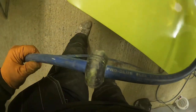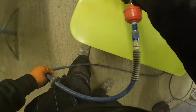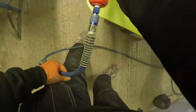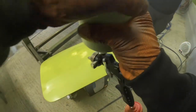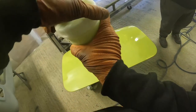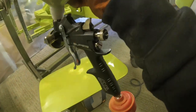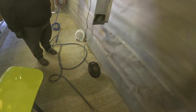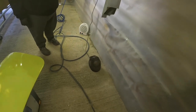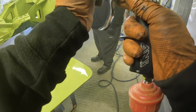And I don't know if it was just a little piece of blue roll or something that got in there from when we were wiping it out after degreasing the gun and giving it its initial clean out of the box to get all the assembly oils and things off it. But there was just something not right, and that's why I was even checking the cup, making sure it wasn't restricted or something in there, making sure that the top hole, because if they block up, they can restrict the paint flow. So I was just testing it on the plastic on the wall just here, just to see what the fan pattern was doing, and it was mega bottom heavy, so it was pretty obvious one of the horn holes was blocked. So it was just whip the air cap off and have a quick look. And it soon got sorted. Dan just whipped the air cap away, brushed it out and blew it out, and away we went.